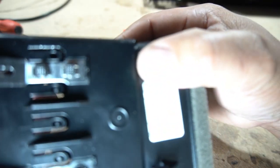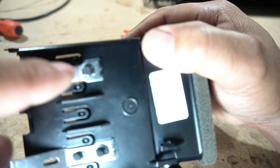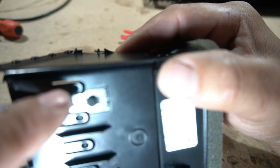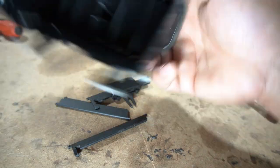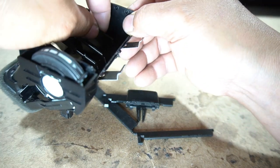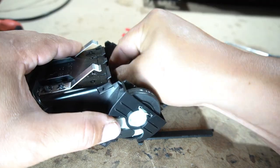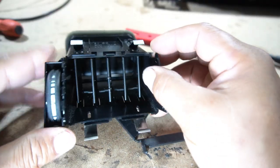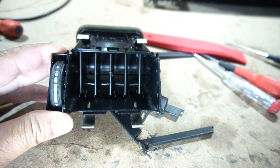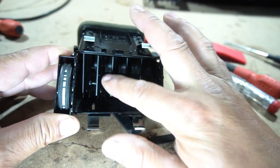Now I'm going to put it back in. All I'm doing is following the hole and making sure it is seated back into that hole. Then the top one — we do the same thing and it will clip back into place. There we go, it's back in. Now we'll just work on getting the bottom one back in as well. That's what you want — you need to make sure that the louvers sit back in the bracket so that it moves as one.